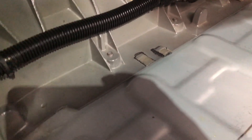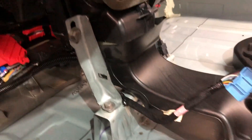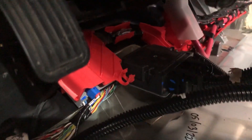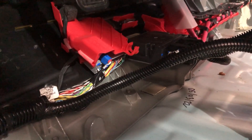This is actually the top of the battery. In the regular Model 3 and Model Y, this would have had a floor — stamped steel pieces welded together — and you wouldn't be able to see the top of the battery. Listen how dense that is. I foresee that's going to be a difficult thing to get off the top of the battery. All these ventings are mounted to the battery, and as it comes up from the bottom of the car, it's all slip fit — everything's designed to fit up nice from the bottom. That's the RCM, the restraint control module. On other models, it's mounted directly underneath the center console, but since this is attached from the bottom up, it's now relocated up onto the gigacast, so it remains with the car itself.